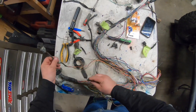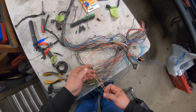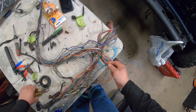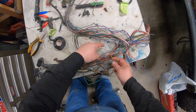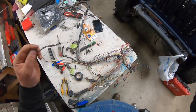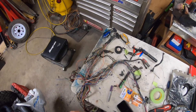Now this is your camshaft sensor. This black and blue wire is your ground going down there. One of these wires is going to be reused for the tach emulator, which is probably going to be this one right here — guaranteed. So I'm going to tape that — that's for the camshaft. I'll verify and make sure that's where I need the pin-out afterwards.